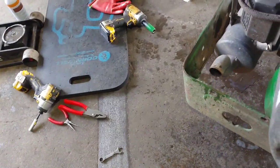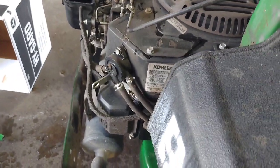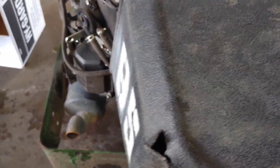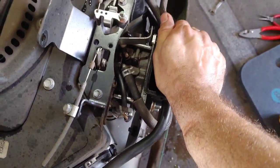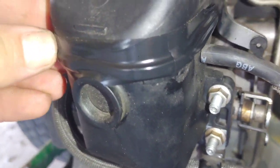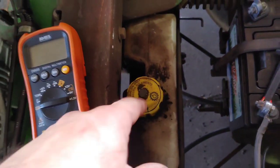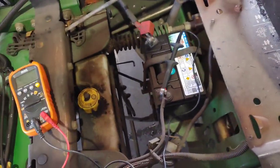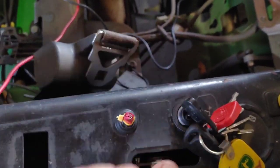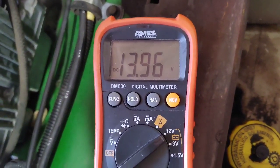What you're seeing is water that was in the muffler burning out. I'm letting it warm up — it sounds a little weird without the air filter installed, that's what's causing that awkward noise. As I put my hand over the intake it kind of kills that noise. To temporarily test the unit I put some electrical tape around the broken seam. Before taking it out to the test field I'm checking the oil levels — no water in the engine oil — and making sure the battery is charging properly. I'll put a link in the description showing how to check the mower's charging system.